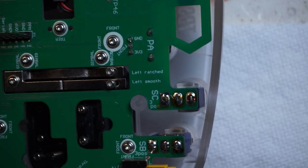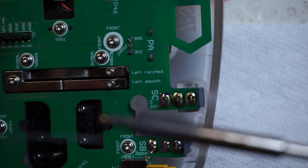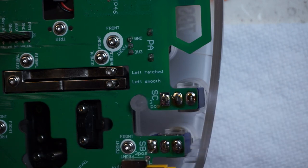We're going to need lots of heat on this one. The switches are oriented exactly the way they need to be - a little lower here than on the top. At 850 degrees, I don't play around - I go in hot and quick. Get a little solder on there just to make a thermal bridge, and let's go. One down - bingo! I think we got it. Pro tip: when you're done, put a bunch of solder on your tip before it cools off. Don't clean it off, just let it sit - keeps oxygen from getting to the tip and keeps it from oxidizing.